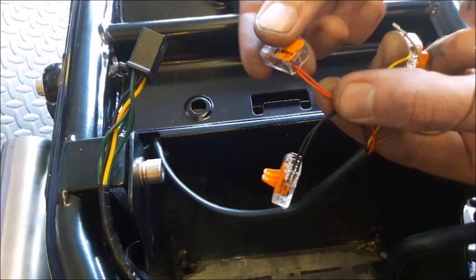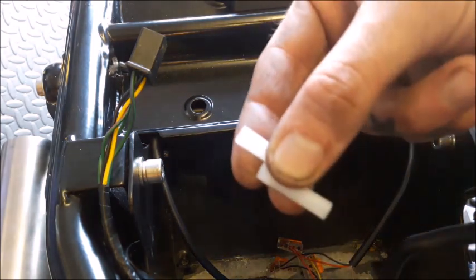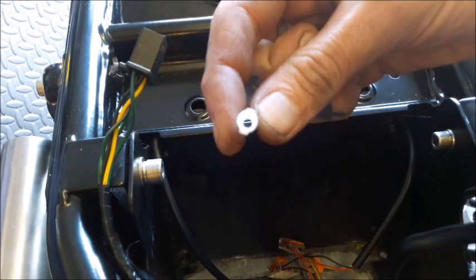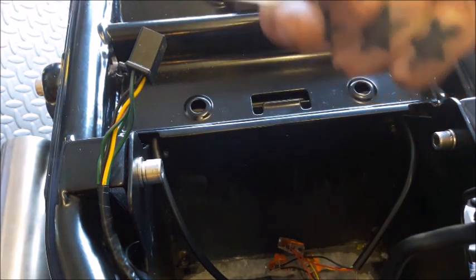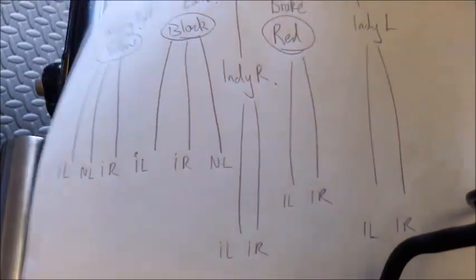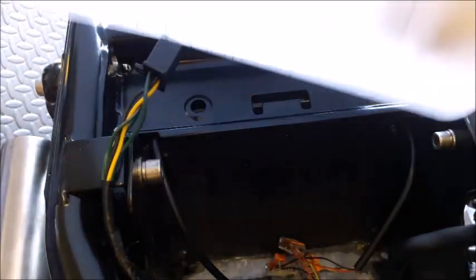I was looking at these and I did even wonder, shall I just stick with these? Because on the front ones I used these connectors. I've got a load of these because these are back from when I had a Triumph Speed 4. These are the OEM style connectors they use on those, some Molex type, and that is smaller than M8, which means that if I need to take the front indicators off, that passes through the nut and the hole as you need to. But I can't really do that on the back here because I'm going to end up with 12 connectors. If you look there, you can see how it goes from the loom, so those 6, into a midway connector if I was using the stock Triumph one, and then into what I've actually got, which is all those.